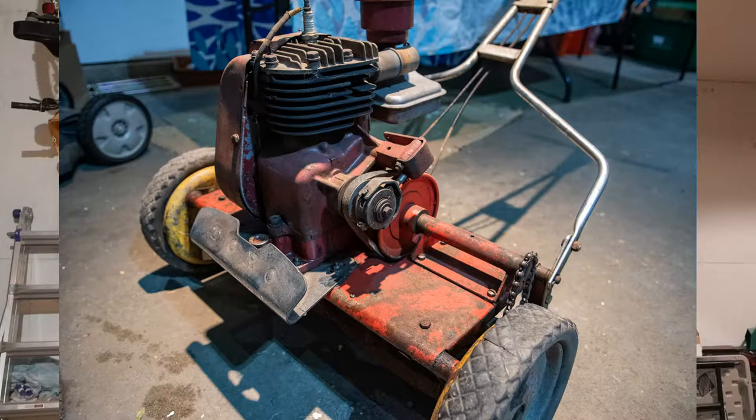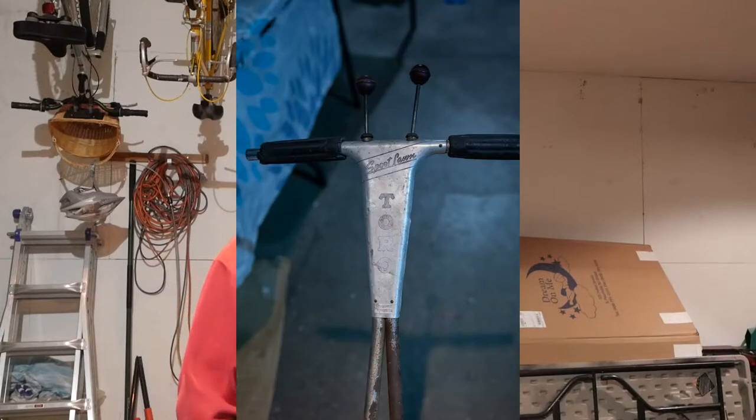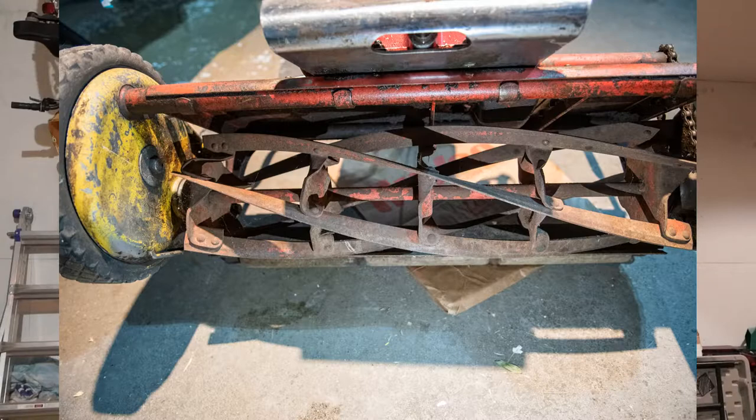So far after working on it, I had to take off the recoil. It has point contacts — essentially there's a little contact that keeps going like this every time the coil goes around, and that can easily corrode. So I took some sandpaper, I think 80 or 120 grit, rubbed it, got it in between there, cleaned off the surfaces, put the recoil back on and got it sparking.